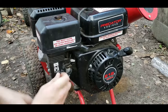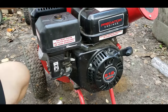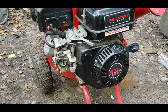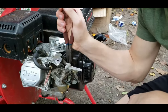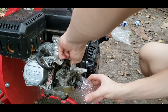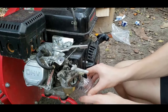Now we're going to be taking two 10mm nuts off, and that's the only thing holding this on other than the upper clamp that goes into the gas tank and the one that goes into the overhead valve cover. You're going to have to use pliers to get the top one out, but the overhead valve cover does not have any clamps on it. I'm going to use some pliers to remove the clamp on the fuel line and we're going to proceed to drain the gas into old water bottles. Make sure you have a bunch on hand if you have a lot of gas in the tank.